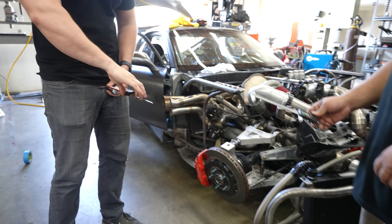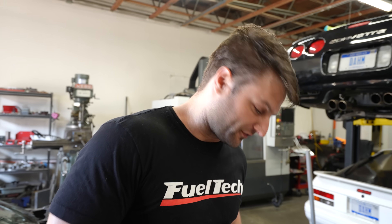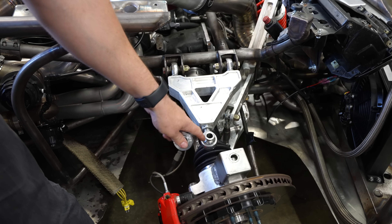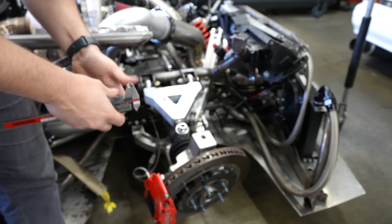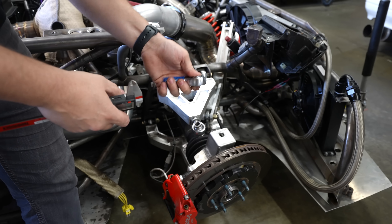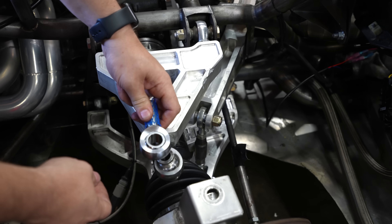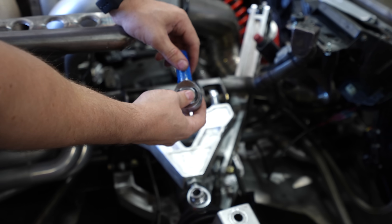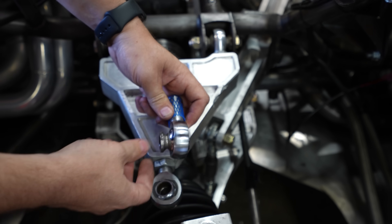Do we have a problem? This is named Brad — it maxes out just like me, six inches. We've got an issue we've always known will be kind of an issue. When you think about how this car is built, it was built from the front control arms to the rest of the car. As many of you know, especially FSAE guys, these are heim joints and you're supposed to load against them like this, not up and down. That doesn't mean you can't use them like this, it's just frowned upon — the reason being that over time they wear out much quicker. So what we're going to do is replace these really cheap ones we had to mock the car up with, and replace them with some really high-quality ones meant to hold more of the load, especially the lateral or side load. They're self-lubricating and chromoly — the old ones are basic steel. These are like $40 a piece; the old ones were like $6. These are the high-angle pieces so you can go to a higher angle. Those pop in and out and you're good to go.